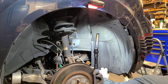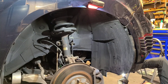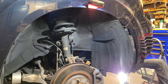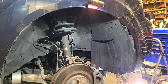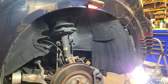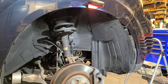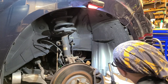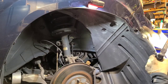I'm gonna remove one more clip just to be safe. These up here are coming out pretty easy even though they're dirty and got salt and stuff on them. That should give me some pull. It's common for this stuff to happen from rust. I still have three 10-millimeter bolts stuck in, so I'll figure out how to get them out — I think I'm gonna use pliers on top and pliers on the bottom and work them back and forth now that I've got access. All three of these guys broke off. From there we got enough access to wiggle — just fold this out of the way. Just like that.